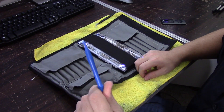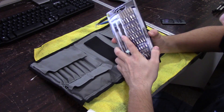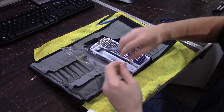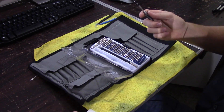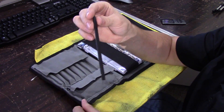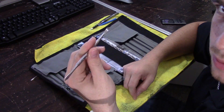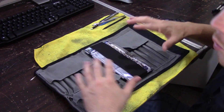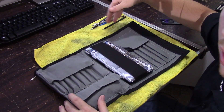iFixit likes to call this the iPod opener. For the screwdriver set, the main one you're going to need is a PH000 bit. I think there's only five screws in this whole thing. A plastic spudger or nylon spudger, also known as black sticks, and I'm going to have a metal spudger just to be on the safe side. I'll have links down in the description if you want this kit or a couple of the other ones that are sold separately.